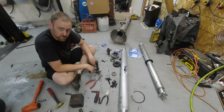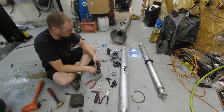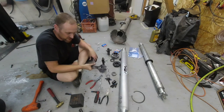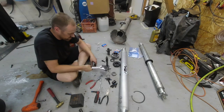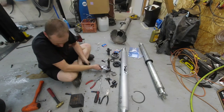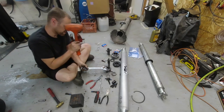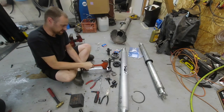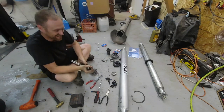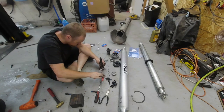I'm just going to slowly put this thing on. I looked for a pickle fork that might fit because of how tall this is, otherwise I have to find a series of adapters. I opened a drawer and found a giant crescent wrench — I thought, I wonder if I could put it like that and hit it with a hammer. We're going to experiment. I'll be damned, it worked! It's all the way on. A nice easy shortcut: you can use an adjustable wrench to put bearings on that aren't pressed too tight.